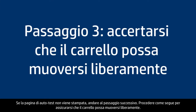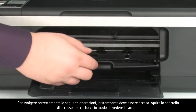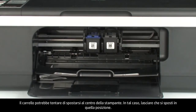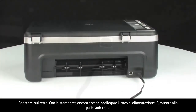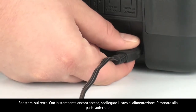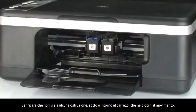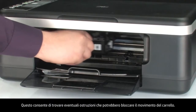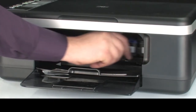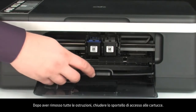Use the following steps to make sure the carriage can move freely — the printer must still be on. Open the cartridge access door so you can view the carriage. The carriage might try to move into the center of the printer; if so, allow it to move into that position. Turn to the back and, while the printer is still on, disconnect the power cord. Then turn to the front and check for obstructions under and around the carriage that could prevent it from moving. Gently push the carriage to the left and then to the right to find any obstructions. Remove any obstructions found, then close the cartridge access door.